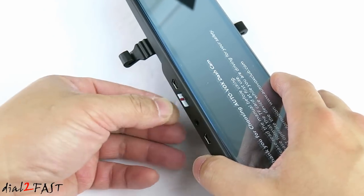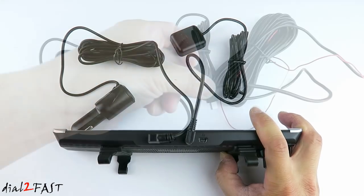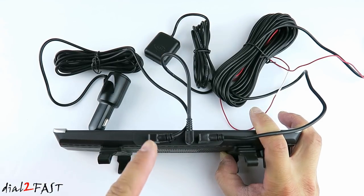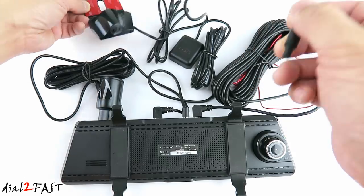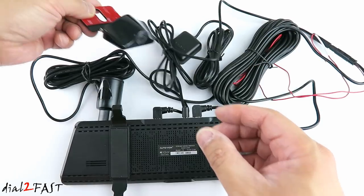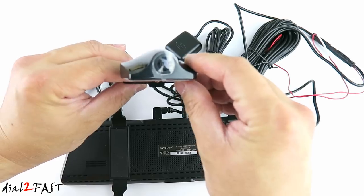Let's first install the memory card. First we'll connect the power cable with a mini USB connector. Next we'll connect the GPS antenna. The last connection on this unit is the AV cable that connects the rear camera. Now just a word of caution — do not mix the power cable and the AV cable, as they both use the mini USB connector. On the AV cable there's a red wire you'll need to connect to the backup light so the dash cam will know when you have the car in reverse. Connect the rear camera to the other end of the AV cable. The enclosure for the rear camera is all metal — very solid, including the bracket. This camera is also IP68 rated so it's waterproof and dustproof.